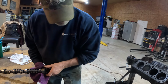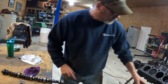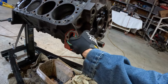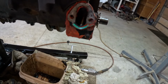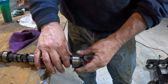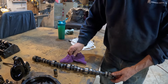Yeah. This front one. Oh, yeah, that's one. The front, because it's got these bare bolts. This is the front one. It runs your fuel pump. There's the fuel pump there. There's a rod. That's the oil pump. Okay, the fuel pump. The fuel pump bolts right here, and there's a rod. It's right there. What's all this crap? Silicone. Okay. See that rod right there? Yep. That metal rod. It runs on this. And as this turns, that thing goes in and out, and it pumps the fuel to the carburetor. And as it's turning, that's turning the distributor to tell it when to fire each cylinder.